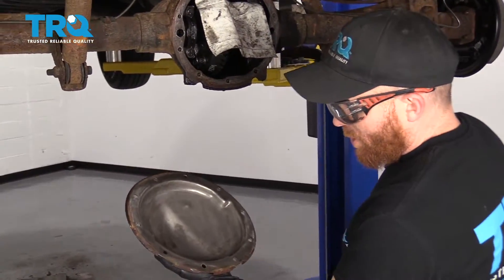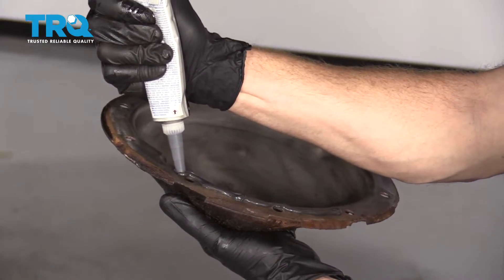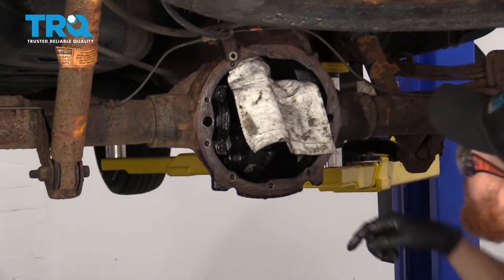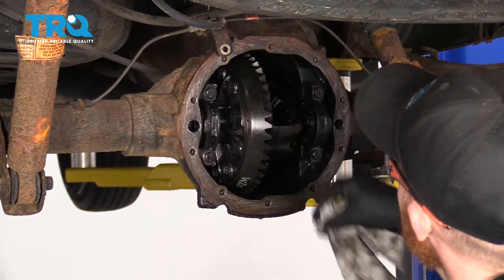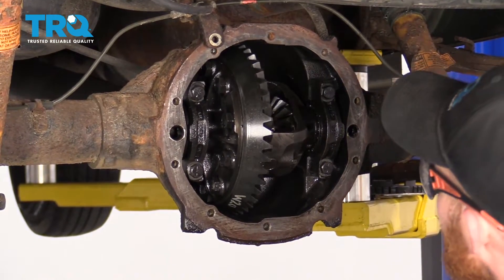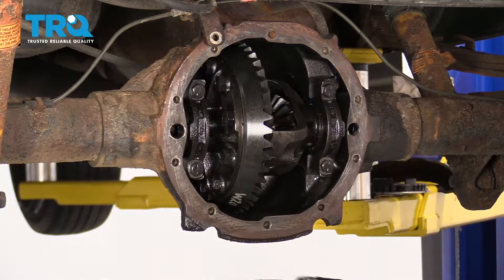Once you've got it nice and cleaned up, we're gonna continue on with some gasket maker — I'm gonna go right along here. It's important to use stuff that's oil resistant, because of course inside the rear differential is oil. Now, we're just gonna look up in here — remove our rag, take a double check, make sure we tightened up that bolt. We've definitely got our pin in there and got the fluid out as much as we could. Make sure you clean down around this whole area so there's no oily residue, because if you do, the RTV or gasket maker isn't gonna stick.